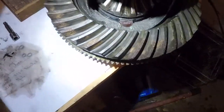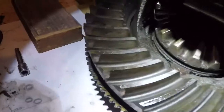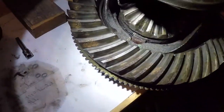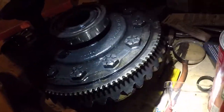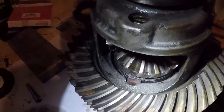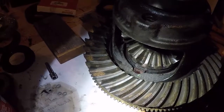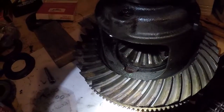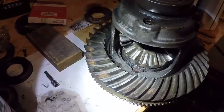The more I think about this, the less happy I am about changing one of these gears. Since I had to put the pinion back in, and since this thing has been worn in special to that worn-out piece of crap, I'm going to give it a buff. I'll use a little bit of emery cloth to bash the rust off and put it back in rather than take a chance on ruining my gear set that I know is still good from my 97. I'll just scuff up the teeth, get the heavy corrosion off, clean it up, and get it back into the unit.